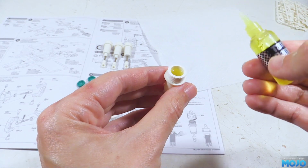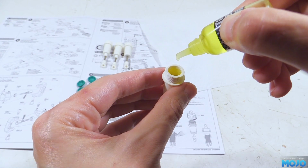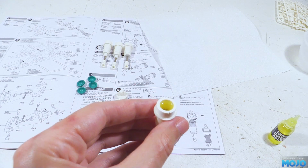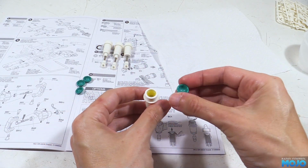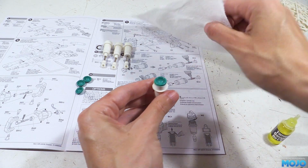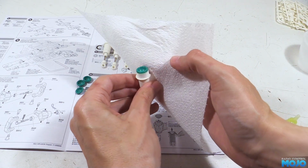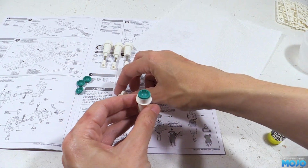Alright, now we can top up the level, again a millimetre or so from the top. There's no point in going all the way up, as the bladder is going to displace the extra oil anyway. Which brings us to the messy bit. We need to pop the bladder into the top of the body so the cup shape goes down into the oil. We want to see a small but healthy amount of oil seep out as it settles into place. If no oil comes out, there's a fair chance you've not quite got enough oil in the body.